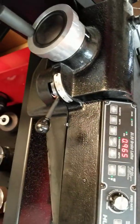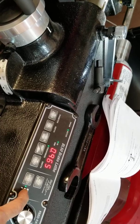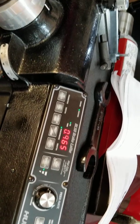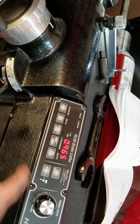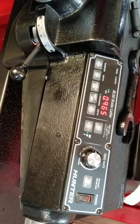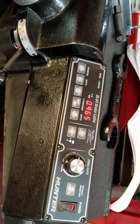Another thing — for normal cutting, if I want to do one pass, what speed should I choose? Put it in the middle. When you choose fast, you're going to go really fast, because it's proportionate — the faster the spindle spins, the faster this moves out. If you're on fast and coarse you'll be going really fast and you're not going to get a good cut. Medium and one cut — that way you'll get a nice smooth cut. So you recommend middle or slow? Middle. Slow is too slow. Medium speed and one-pass cut is best.